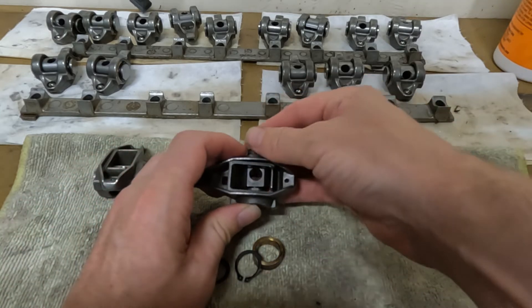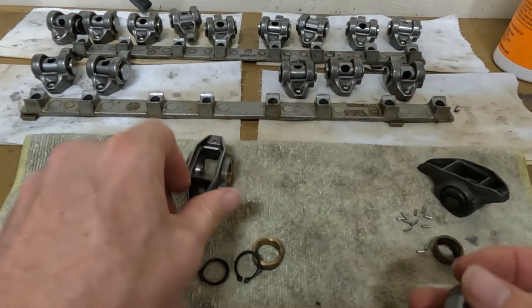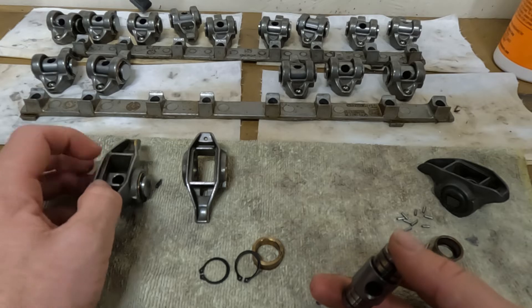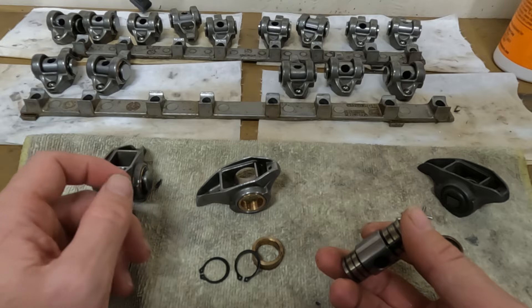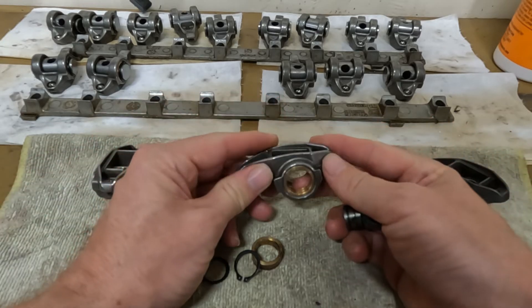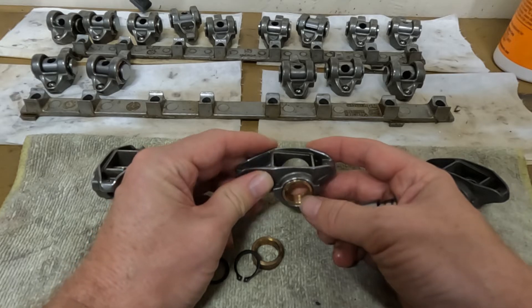For many people that may be a moot issue — if you're just driving a short distance, drag racing, doing whatever, you're not a high-mileage car. This happened to me at 12,000 miles. I have a tight spec preload on my lifter, so I ate up all that preload. That little groove set me to zero lash on almost every cylinder.